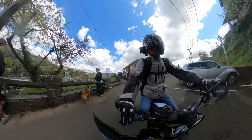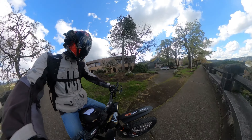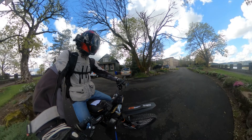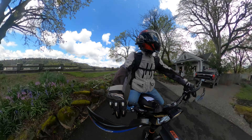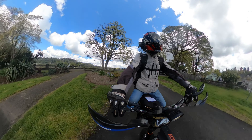Some of the nuts and bolts on this bike are so tight you can't even hardly get them off, and then other bolts are completely loose, almost finger tight. Some bolts were loose, some were over-tight. My gear oil was supposed to be between 125 and 150 milliliters and it only had about 50 milliliters in it. If you're buying or have one of these, I would totally go through and check all your nuts and bolts. A lot of them had Loctite where they're supposed to, which was good. And check the oil in your gearbox — I only had 50 milliliters in mine.